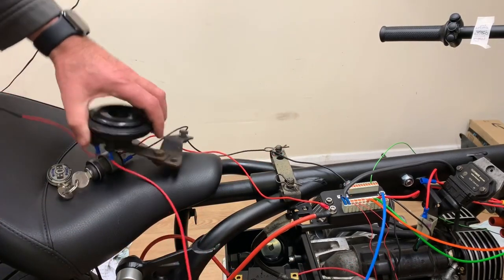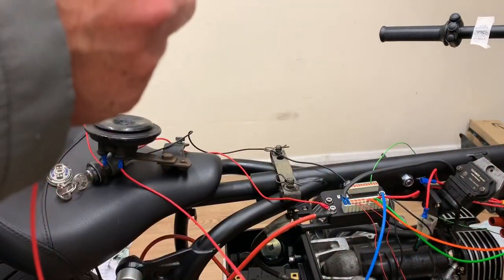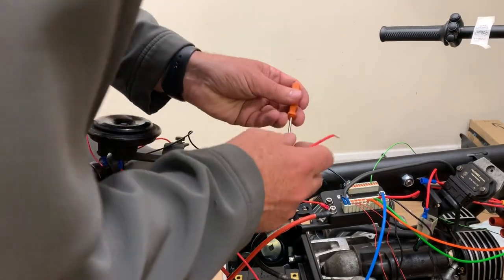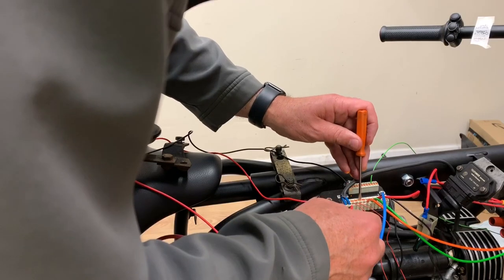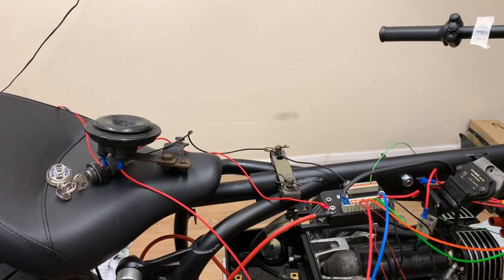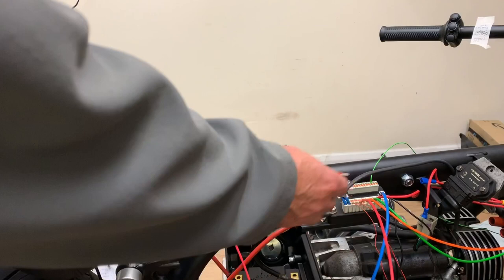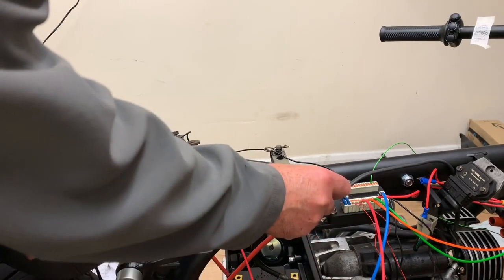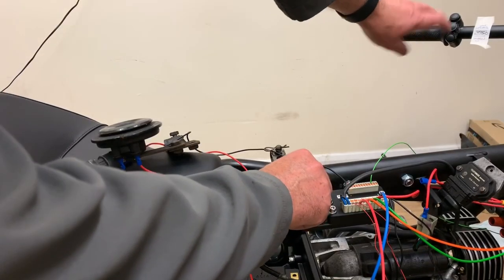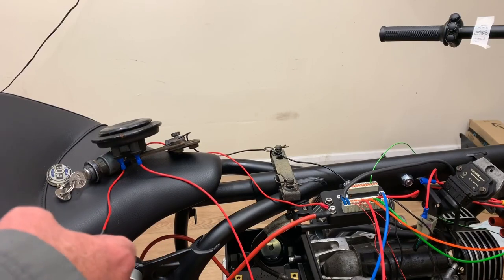One, that's about there. One I will wire into the horn output. And the horn output is that one. Okay. Then I need to earth the other end, which I'll just do by holding it on the earth terminal. And then if I hit the horn button, it's going to be loud, this. It bloody works. How easy is that?